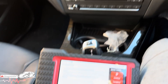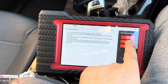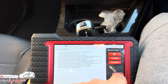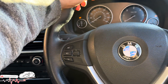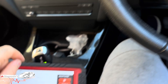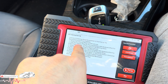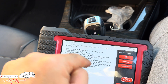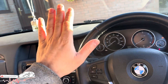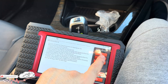It's recoding it back in — continue. It's completed. Now slowly turn the steering wheel to the left — I'll certainly do that. Hold the steering wheel at that point, all the way to the left, lock it in, then go to the right full lock, hold it, then go back to neutral. We'll hit continue.